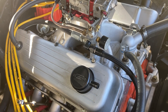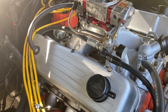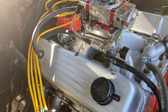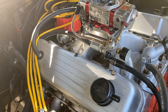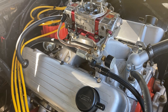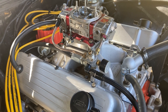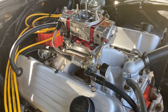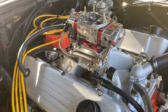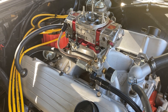If you're having issues running hot at idle and you're not running vacuum advance at all, try hooking that up and try running full manifold vacuum. You'll see as soon as you hook it up, your engine's going to start running faster. So you can turn the idle down to get the throttle plates closed more, taking in less air, less fuel. If you're burning less air and less fuel at idle, you're not going to make as much heat, which is a good thing.